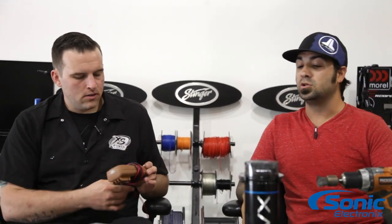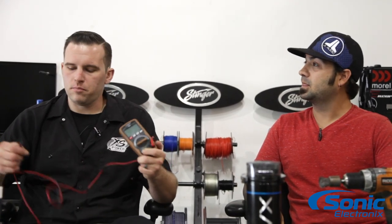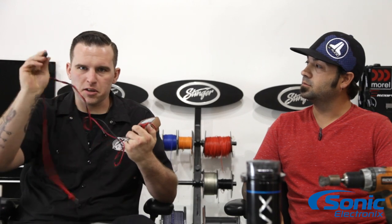It's always really important to have a good ground with every kind of electronic device you're hooking up. So use your multimeter — probe the red to your constant power source in the dash and start poking around until you see 12 volts, or do a continuity check between the battery and that piece of metal in the dash to see if it beeps, and you're golden.